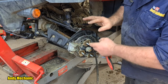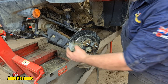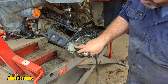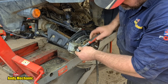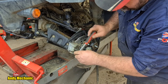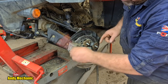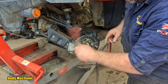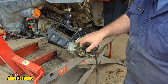The front calipers are accessed by taking the front wheel off. Usually the first thing people want to do is undo the caliper from its mounts, but don't do that. What we need to do is just crack off these two bolts here - they hold the brake pads in position. Not easy when the caliper's still mounted. Be sure your allen key is all the way in on the heads because they can be quite soft and you can round them off pretty easily. Just most of the way out is fine. Now it's time to take the caliper off its mounts.